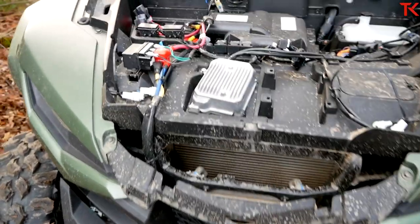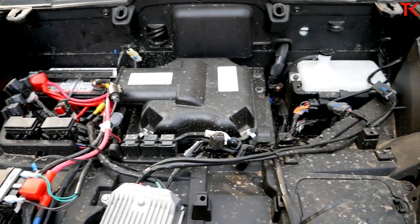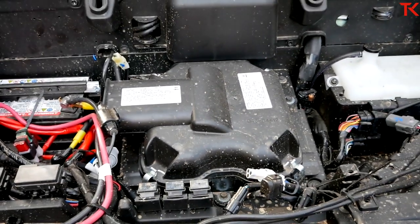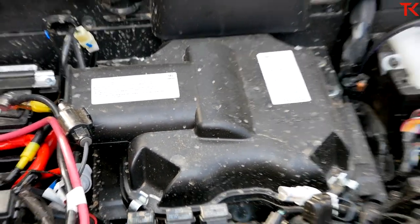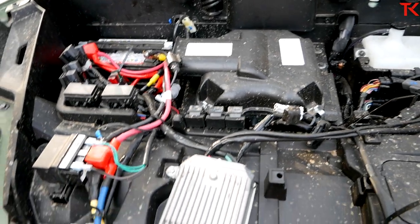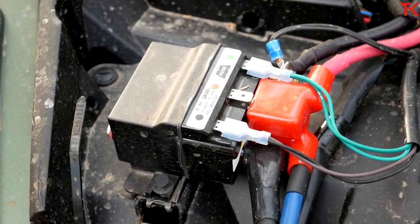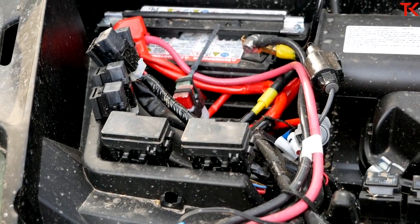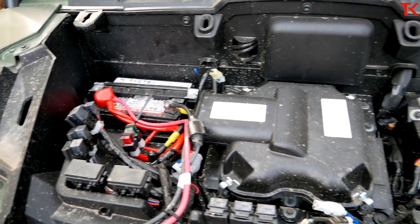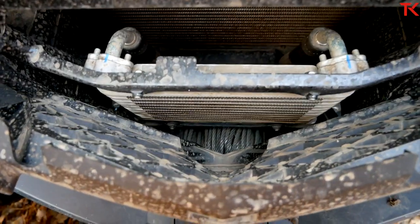Let's quickly peel the hood off the RMAX and see what's underneath. The engine is in the back, so that leaves all the space up here under the hood for everything you might need to access. There's the battery, there's your breather box — which also shows you how high the water can go on the RMAX — and then there's your coolant reservoir. There's also what looks like the winch controller, a couple of fuses, and some relays you can get to. Nice that those three key items — coolant, breather, and battery — are all really easy to access under one hood. You can also get right down to the radiator to clean it up if it's gummed up.